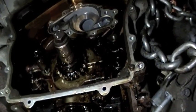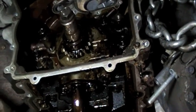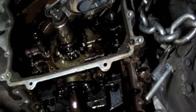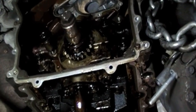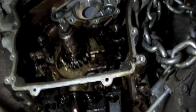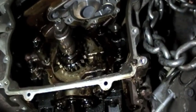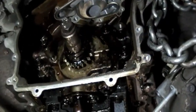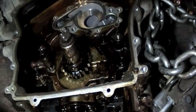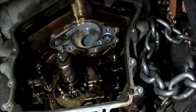Because I don't really know the history of this car and I didn't run it very long, a lot of people have problems with the oil light coming on. Sometimes people say it's a sensor - yes, it can be the oil pressure sensor - but also when you do begin having oil sludge, this oil pickup tube, which is right here, can become clogged and damage your oil pump. So I'm going to go ahead and replace this oil pump, because I want this engine to last me a long time and I don't want to have to be pulling it apart again.